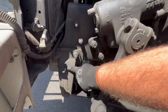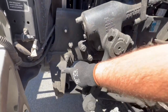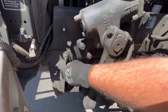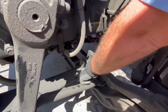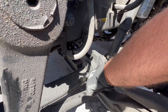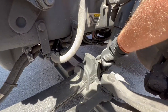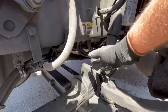These are your leaf hangers — one here and one in the back. Your leaf hangers are properly mounted, secured, not cracked, bent, or broken, and not missing any nuts and bolts. Your leaf springs go all the way across — they're properly mounted, secured, not cracked, bent, or broken, not scissored, they're on top of each other, and none are missing.